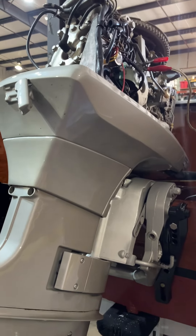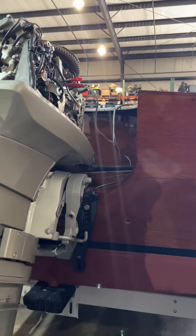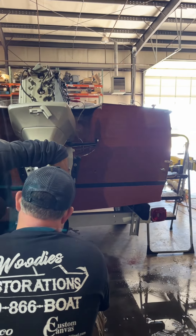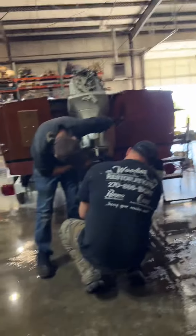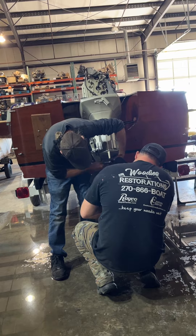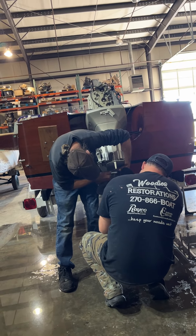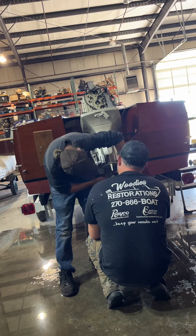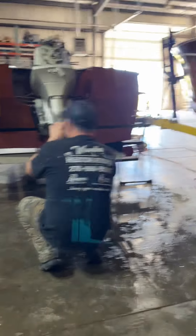We think that that wire is shorted out to the casing on the engine, and it probably had the insulation eaten away. We're working on that piece right now, figuring out why — when we went to shift it into reverse, the engine dies. The only problems we've had with the engine so far have been electrical: those parts with deteriorated wires, and now this other deteriorated wire that goes down to the shift solenoids.